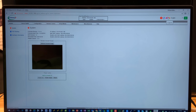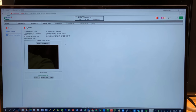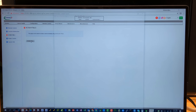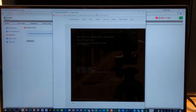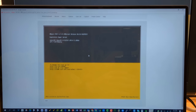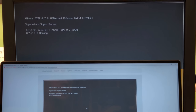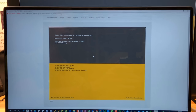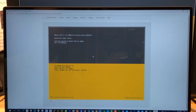In IPMI we've got remote control via HTML5 — clicked it in the drop-down. It should come right up with no Java needed. Hit a key and we get the yellow screen — nice, the screen came to life behind me as well. It's just showing the exact screen of the server over your web browser. The DHCP told us an IP address of .21, so now I know how to get into the ESXi host client.